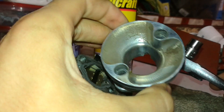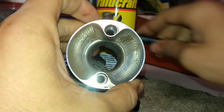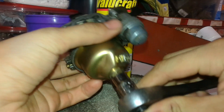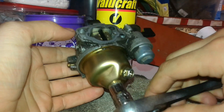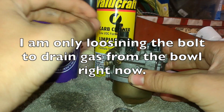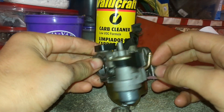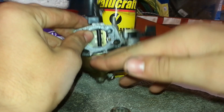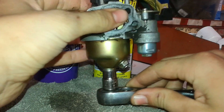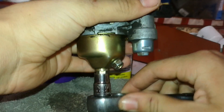This is the adapter for the air filter — it cleans really easily when you spray it with carburetor cleaner, it just shoots right off. First I'm going to take the bowl off. This is where the gas stores, like short-term storage. When it first comes in, it builds up here, and when the float closes, it stops it from going in, just so it has a constant flow.